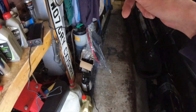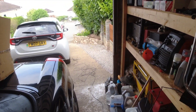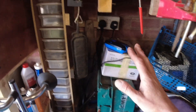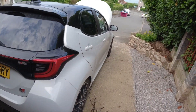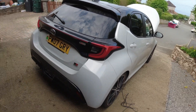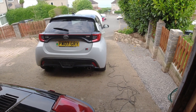But doing it the way I've done it here — maintenance charger connected to the car, lead run to the charger — the charge is nice and safe, nobody can get to it, it's dry. All the connections are inside: this connection is in here so the weather can't get to it, that connection's in the car so the weather can't get to it. Car could be locked, left, and walk away — forget about it. Guaranteed that car will start. It's that simple, it's all you need to do.